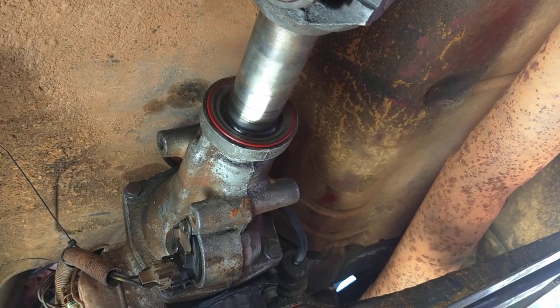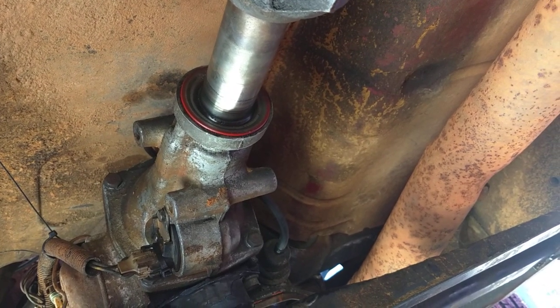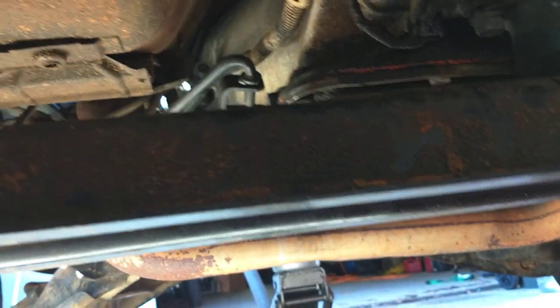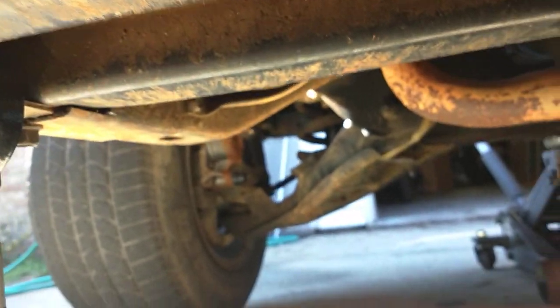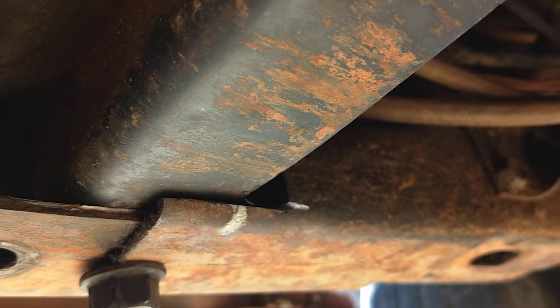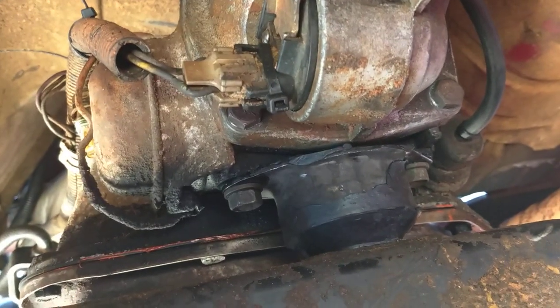After the swap was done and I drove it, I noticed a lot of vibration and noise. I jacked it up and found the transmission mount — right there — was broken in half. You actually have to move the crossmember forward an inch. I thought the installer had already done that, but it hadn't been done. You basically have to cut into the frame. Right there where you see the front of the crossmember is where they had to cut to slide it forward, so the transmission mount lines up and the bolt holes align — otherwise driving rips the transmount apart, which is exactly what happened.